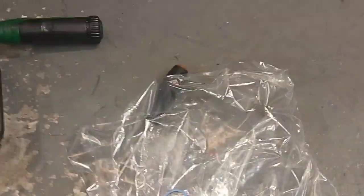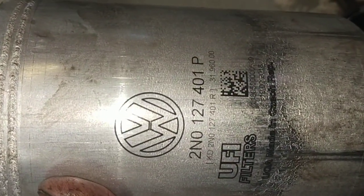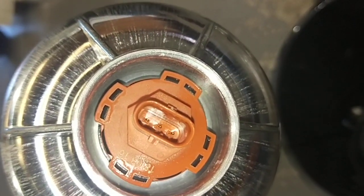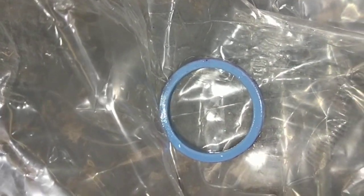Make sure you empty the fuel first. This is a brand new diesel fuel filter for the Crafter. The only thing you need to transfer over from the old one is the plug down here, which is an 18 millimeter. When you do it up, just nip it up a little bit — not too tight, because you'll break the plastic. It also comes with a brand new o-ring; make sure you place that o-ring inside there.